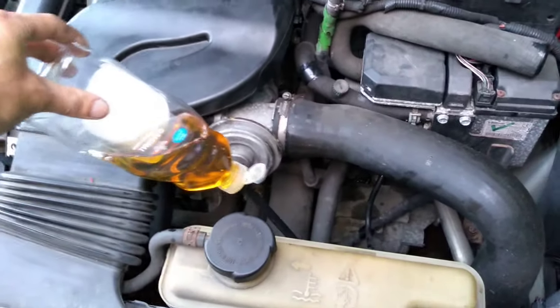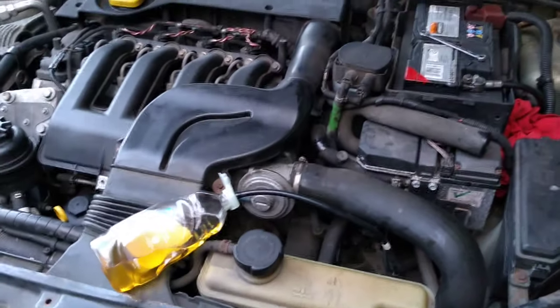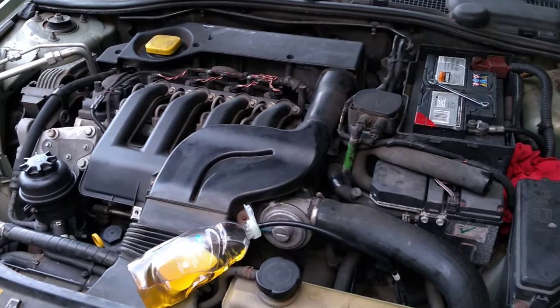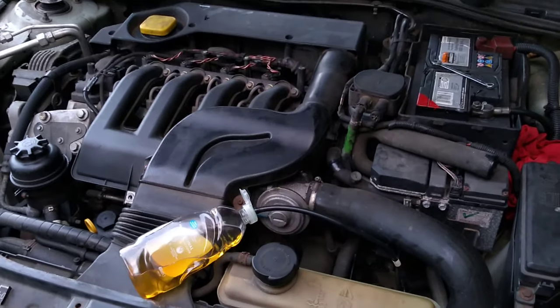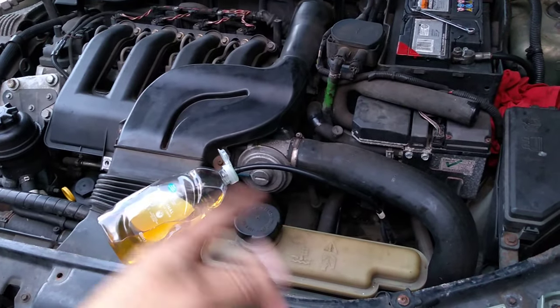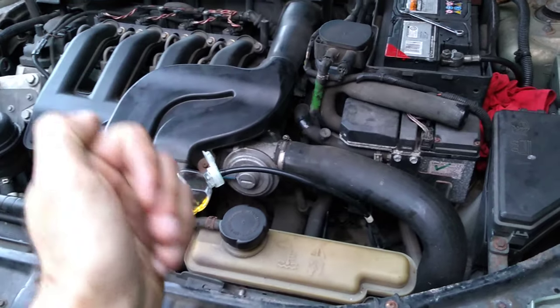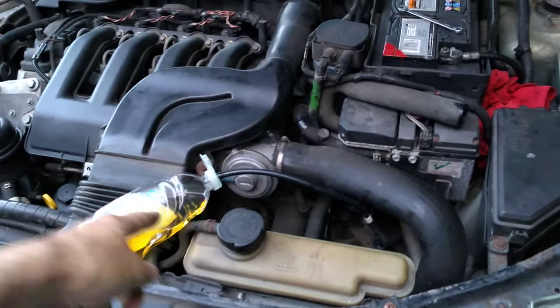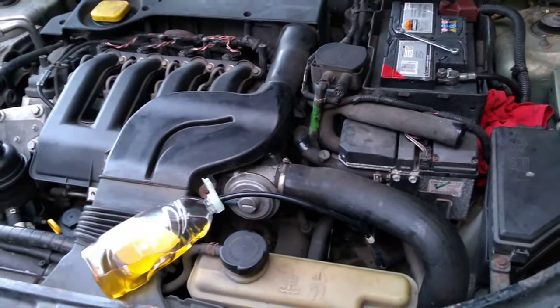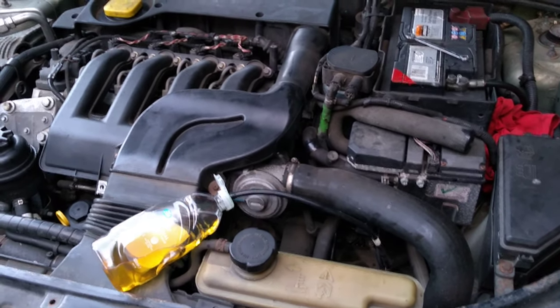It's worked very quickly. I say you can buy these kits, but I didn't really want to spend the money. This is like a £300 car. I don't want to spend anything on it more than I have to. But there you go. Washing up liquid bottle, screen washer hose, crack the bleed nipple, squeeze. You should see air bubbles at least coming out this end, if not that end. Crack it off, test your pedal. If it works, great. If not, give it another go. You'll eventually get there.